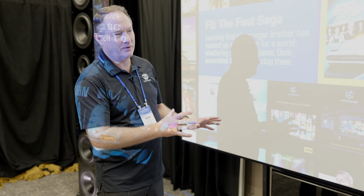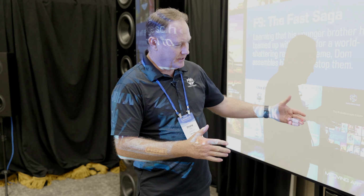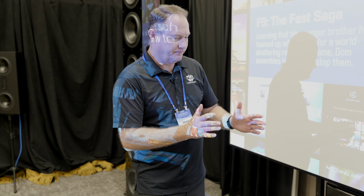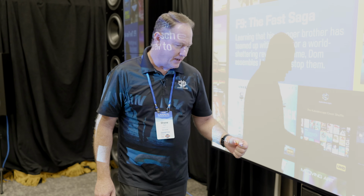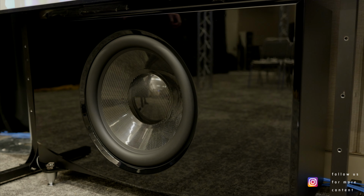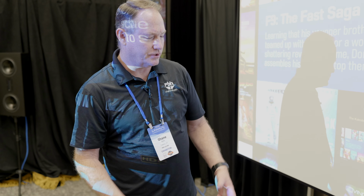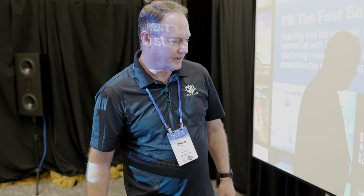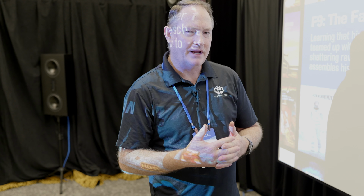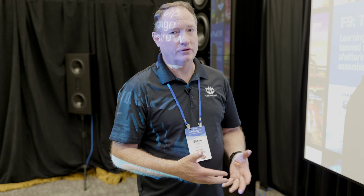We designed it purpose-built for this type of theater installation, where you have a relatively short space that you're trying to fit a subwoofer into. So it's relatively thin, only 15 inches deep, and it's wider, but as you can see, it uses a 21-inch carbon fiber cone. It's a dual-layer cone with aerogel-type damping material in between the sandwich layers, and that helps prevent any spurious resonance from the cone, keeps it nice and damp. It's extremely rigid, very pistonic, has over 100 millimeters of mechanical throw to the driver, so really high output capability. And it has a 3 dB down point anechoically of 12 hertz.